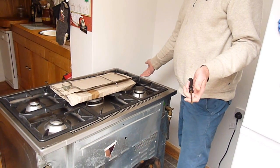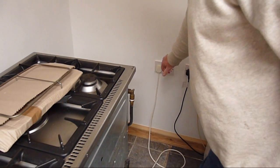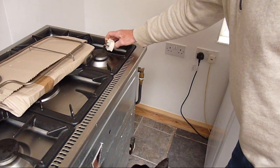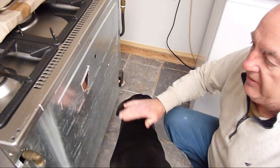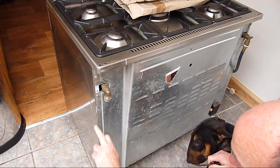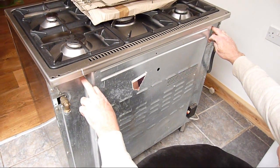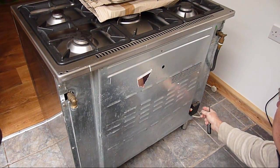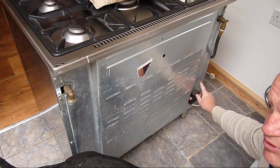It's quite straightforward. If you have enough room you won't have to disconnect the gas, but you'll need to disconnect your electric supply - this is essential to isolate. You'll need to remove all of the screws from around the outside of the back case, the back cover, and the two corner ones shown. Take a photograph of the wires behind the cover to make sure you don't get mistaken.